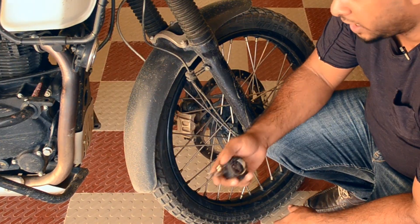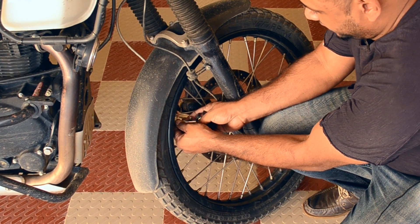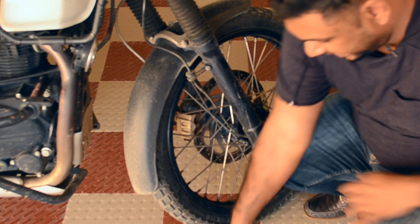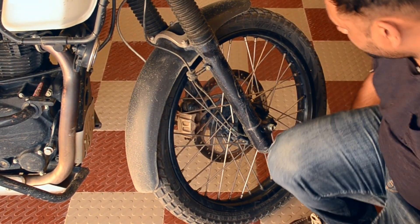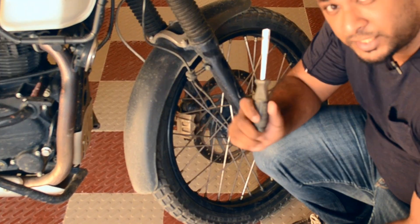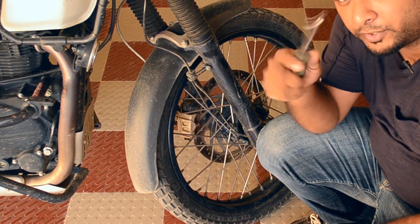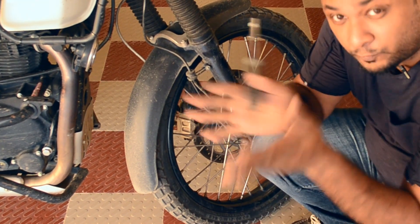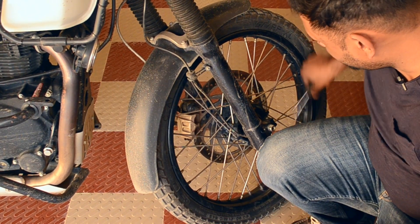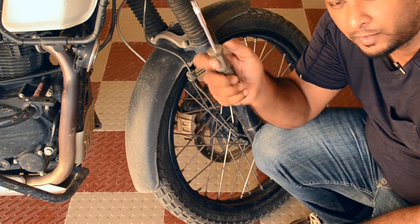The first thing is A for Air. You need an air gauge and make sure that before every ride you check the tire pressure to the desired level for your bike. While you're at it, tap the rim and listen for a 'tring tring' sound — that tells you your rims are alright and there's no problem, so when you're traveling at higher speeds you won't feel any wobbling. Do the same with the rear wheel and you're set.